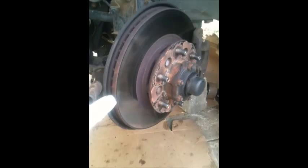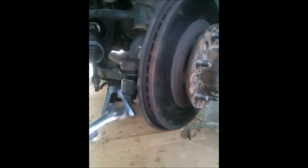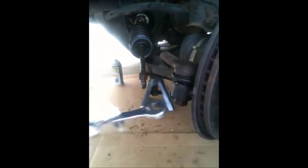Okay, the tire is out on the Infiniti, and I went ahead and untied the adjuster bolt here. So now I'm taking off this bolt. It's a 21mm, I believe. No, I'm sorry, I use a 7/8. So it's a 7/8 that works. So now I need to either bang it here. Sometimes it releases. So this thing here is loose completely.